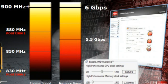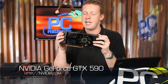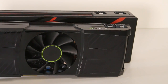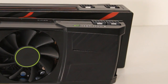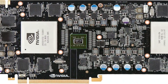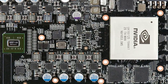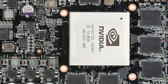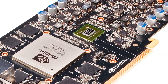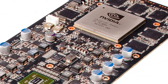This mode is geared towards overclockers — people that want to get more out of their card, the LN2 overclocking crowd as well. We are glad to see AMD supporting the enthusiast crowd with an option like this. The new NVIDIA GeForce GTX 590 is quite a bit smaller than the HD 6990 — an 11-inch PCB instead of 12 inches, and a little slimmer. It's a dual GF110 Fermi architecture design. The GPUs run at 607 MHz compared to the 772 MHz of the GTX 580, with 512 CUDA cores each, for a total of 1,024 on the whole card, and 3GB of GDDR5 memory running at 854 MHz, or 3.4 Gbps.